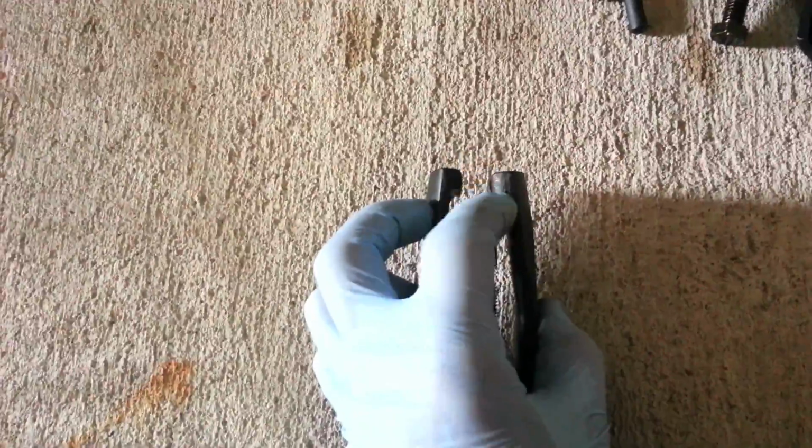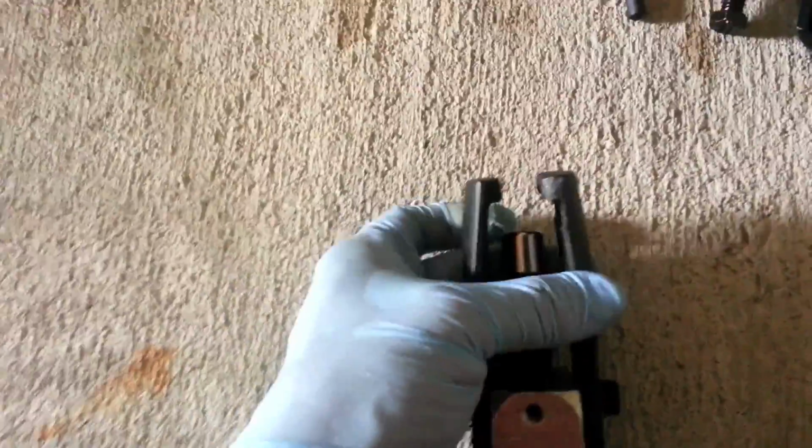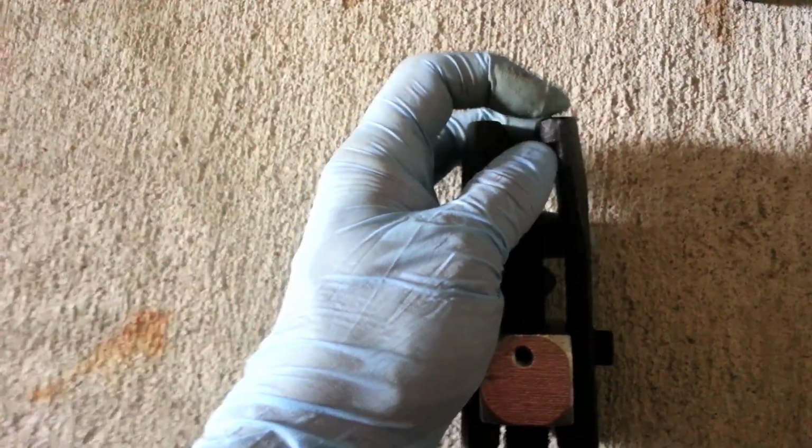This is what would actually grab on the pulley head when you're trying to remove it. But on a power steering pump, I found this universal one. These are too wide. This section here is too wide to actually grab onto the pulley. It's real thin. I'll show you when I get it off. So for me, I found this doesn't work for the power steering pulley. It'll work for other pulleys, but not the power steering one.